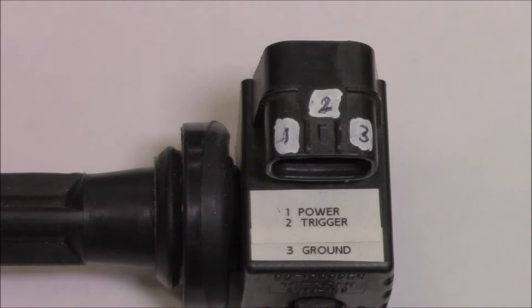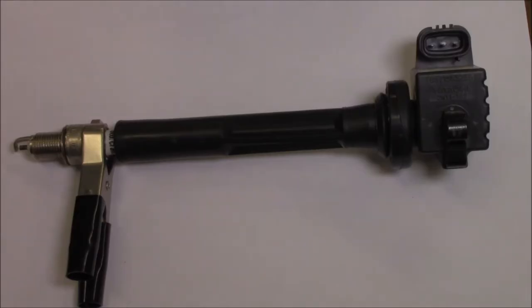In this case I just used this as a training aid, so you can see I've clearly identified each terminal and what that terminal is used for. After that the hookup is pretty simple — just add a random spark plug as well as a good quality earth lead going off to the negative side of your battery, and you're ready for testing.